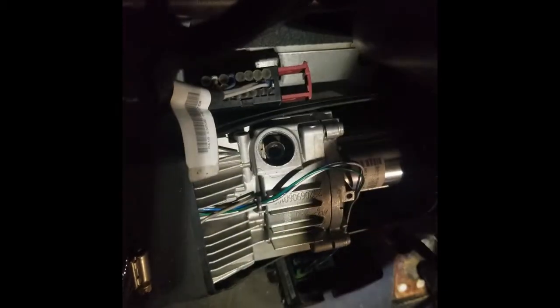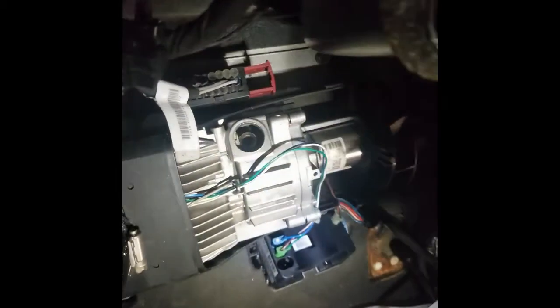Next thing is going to be to clean out the ventilation hole. There's a ventilation hole — it's only about a quarter inch down, points toward the fan motor. You want to get in there — this is where all your combustion air comes through. It's pointing toward me. Can you see my pick sticking through there? You just get in there, wiggle that thing around, make sure there's no carbon in there. If there is, clean it out.